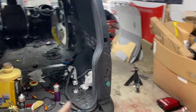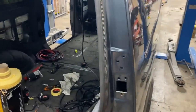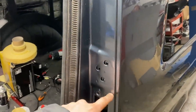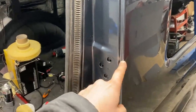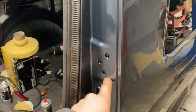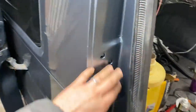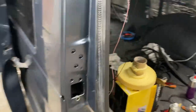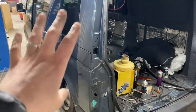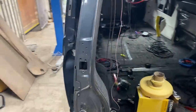So easy! Three bolts at the top, three bolts at the bottom. Once you've got the wiring out, they come off. I've painted this area here in the same body colour because the hinge comes around to this edge and there's no paint there. So I've painted that, primed it and lacquered it. We're not worrying too much because this is all going to have to come apart next year when we paint the whole van anyway, so it isn't a major issue if they're not perfect.